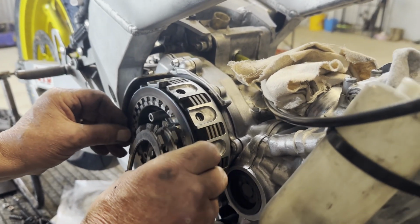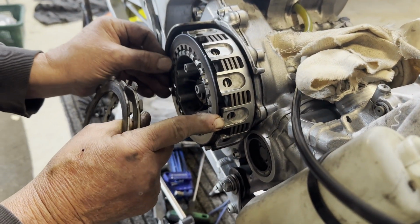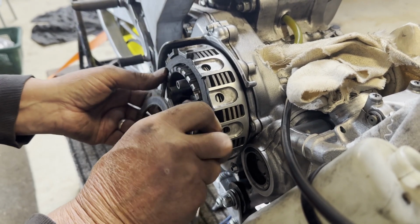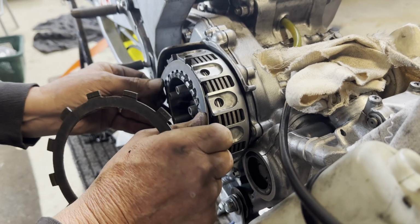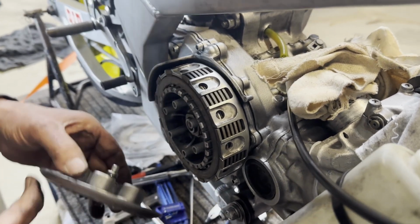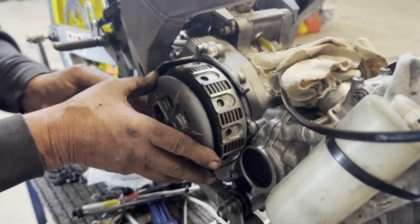And we went to a 6 on it. We put an extra plate in, and they make room for it by running thinner steel plates, and it's good and bad. The problem with the thinner ones is they warp and fatigue quicker and don't last as long. But we get the extra fibre plate in there, which is really important.